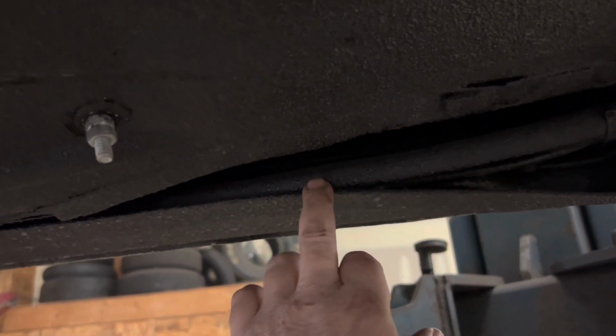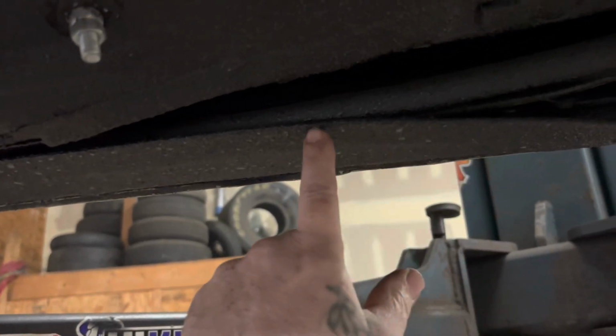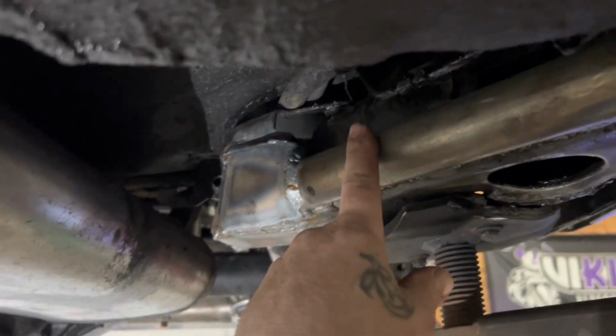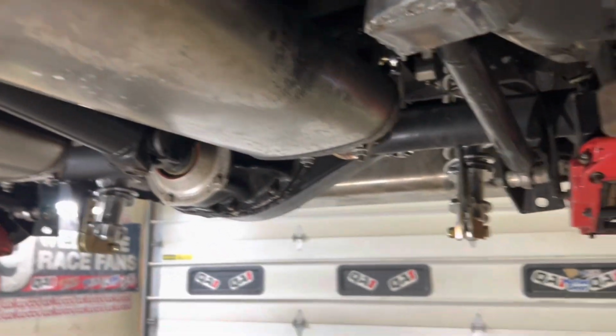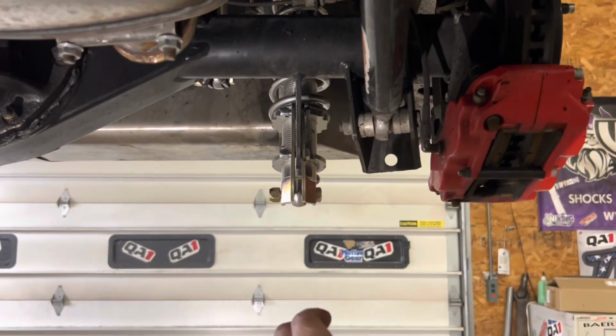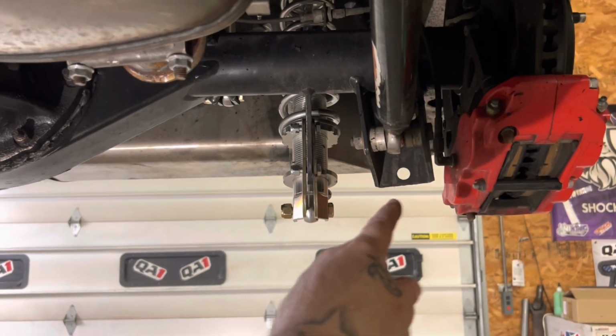And as you can see, the normal thing is people bend these frames up after jacking them up wrong and shit like that. Use a crescent wrench, pull it down, whatever. Put a tube inside the frame rail there, weld it. So now with this being here and all braced up, and to do the ladder bar cross member across there, then you can come right off of that, tie into this. Adjustable buckets on the back would help bring that down, bring it in more, probably get rid of the coilover bracket like that, put it on the back of the box, bring it in.